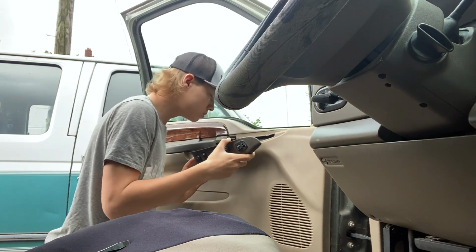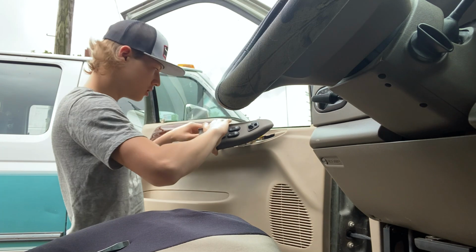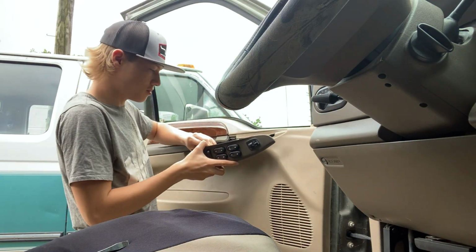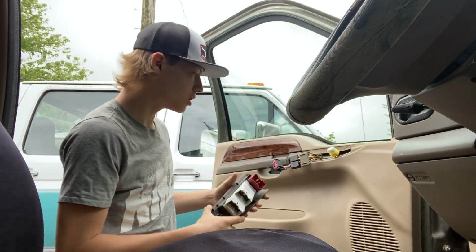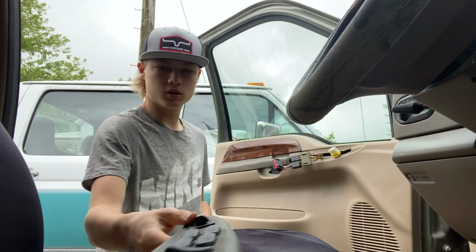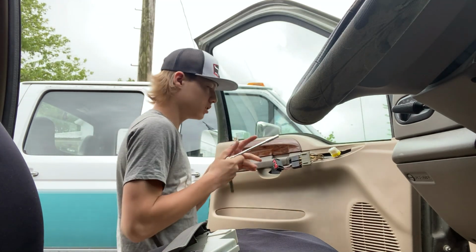It's out. So you can go ahead and unplug these all. And then there's one more bolt right here. Now it's kind of a pain to get these things out. First one's unplugged. Alright, finally got it off. As you can see, this is where the 4 connectors connect, and here's all 4 of them. Now, if you leave this thing sitting here carefully, take your 7mm and take out your last bolt.